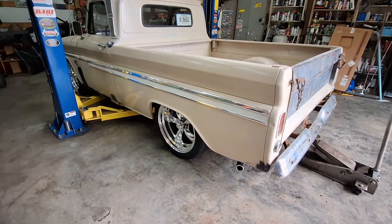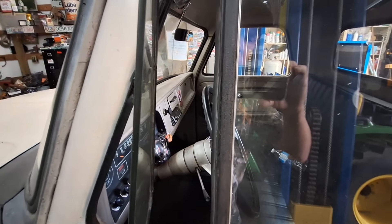If you have a '64, '65, or '66 Chevy truck, Brian's going to explain. A 1960 to 1970 truck has a rear end about 60 inches wide. The '71 and up is like 63 and a half inches. So you've got about an inch and three quarters on each side that it's wider than what the truck should be in a '60 model. The wheels are sitting out about an inch and a half further on each side than they should be. If it had the '60 model rear end, these 20x10s would be hitting your wheel tubs in the back, so you would have to widen your wheel tub. That's about it in a nutshell.